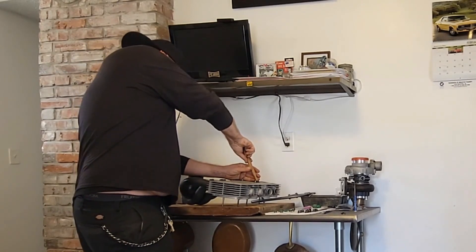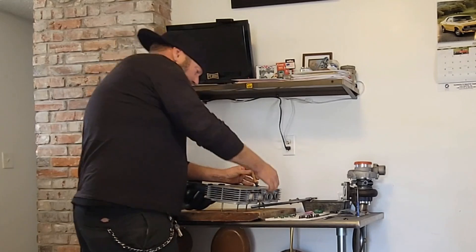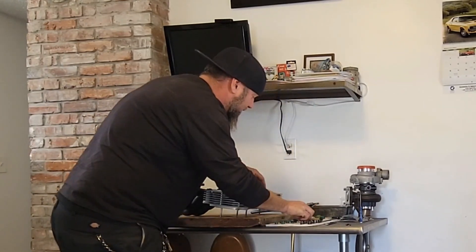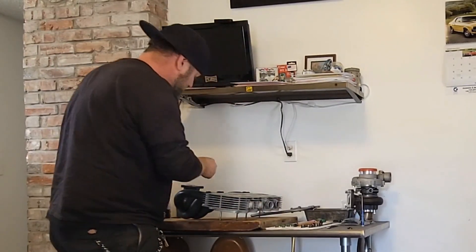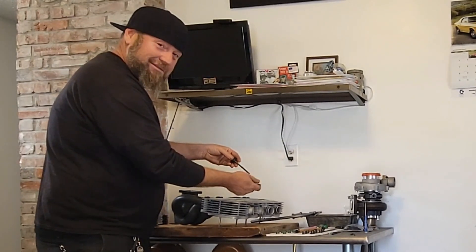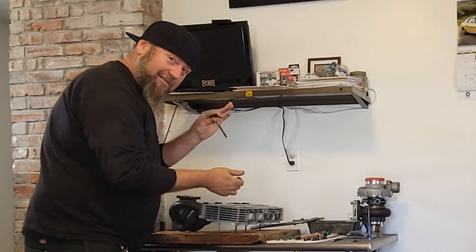You can clean this valve off a little bit more — this suction cup isn't quite sticking as good as it should. But I can definitely see what it's doing now. Yeah, it's looking good all the way around. I've already worked on a couple of them. Nice and good pop — I always hold my finger on the back of the guide when I slide it out. Did you hear the pop? That pop was the suction on the valve — the valve is good.